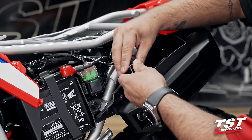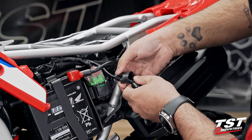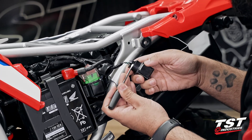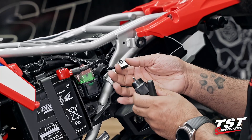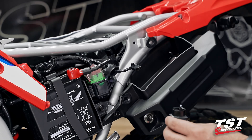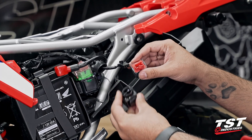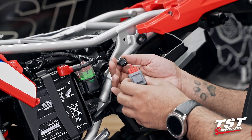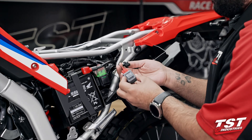However it's a little bit finicky. I find that gently pulling on the boot and removing it from its retaining features is a much easier way to go about this. If your fingers aren't small enough, grab a small tool, push gently on the relay securing post and then push down — that'll disengage it from its locking tab. The relay is now removed. It's important to note the OEM relay has three pins, while our TST two-pin LED flasher relay only has two pins. The third pin on the OEM relay is a redundant ground — because we're switching to an electronic relay we won't need that. The relay still fits and functions as intended, so don't be alarmed by that. Now go ahead and install our relay.